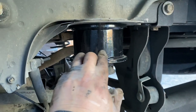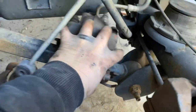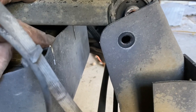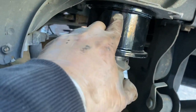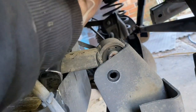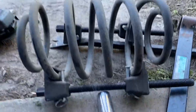All right, so this is the lift in the back. I took the brake caliper out and I'm just letting it rest here. I have this rear upper control arm — or sway link, whatever you want to call it — unbolted. I took a grinder and cut through this gas tank shield because it was already getting banged just by me working on it; this three-inch lift is going to set that off and it's always going to hit on bumps. So I've notched out these cuts and I'm going to hammer it out and bring it down — or maybe I can just grab it with a wrench and pull it down.